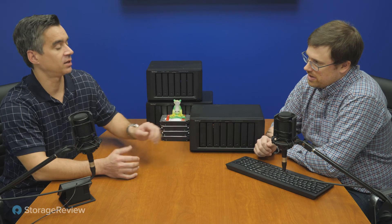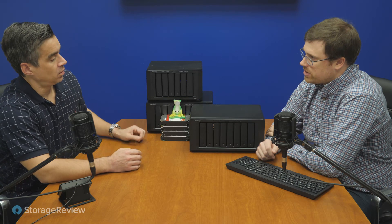The '21' refers to the generation. It comes down to a faster CPU — this unit uses AMD Ryzen instead of Intel on the previous generation. You gain 0.1 gigahertz, but you go from a four-thread system to an eight-thread system, and you also get onboard cache module slots, whereas on the older unit you needed an expansion card to add them.